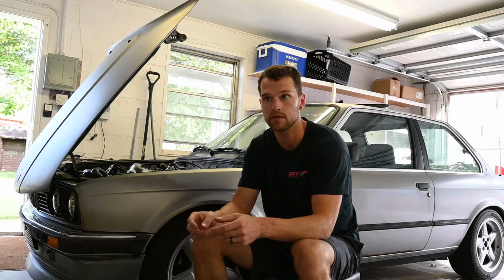Well, it looks like there's about three different places in MegaSquirt that you can identify what O2 sensor you have, and if it's a wideband or a narrowband. I had it set to the LC2 Innovate wideband in two of the locations. There was a third location that it was set to a narrowband. So when I changed that back to wideband and then burned those settings to the controller, the car did fire up first try without needing to give any throttle input.